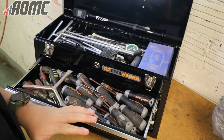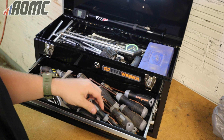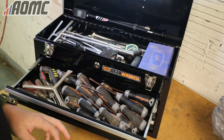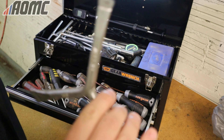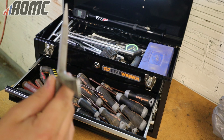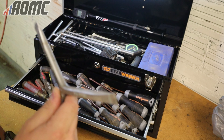In this first drawer I keep my Torx and screwdrivers. I've got Torx in here from T7 to T40. These also bleed the WP forks and do a lot of stuff on KTMs, which I'm riding most of the time nowadays, so very handy. I've also got a timing plug wrench remover by Motion Pro. A lot of people don't use these, but they make life so much easier — you need to remove those engine plugs and it doesn't strip them out. These things are a lifesaver.